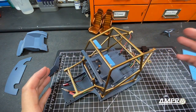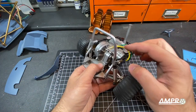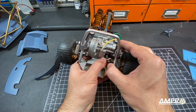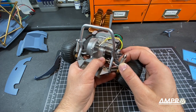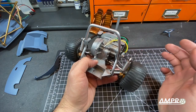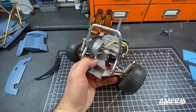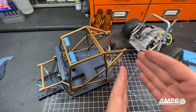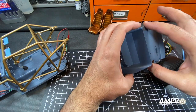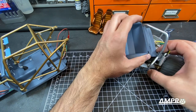To install the rear, we're going to have to first install the back half of the vehicle. I've done a couple things in preparation for this: I have disassembled this clamp and taken this screw out because we want to have a little bit of play here in the hoop. The shock has been disconnected. Now you don't have to do that, but as I mentioned earlier in the video, these are no longer needed — we do have to run standard coilover shocks here, so these are going to go anyway. To install the rear firewall, we're going to have to join the two, but it's not going to be quite that easy. This is the firewall section.